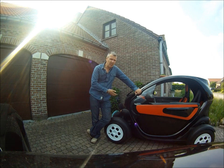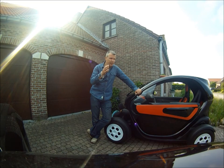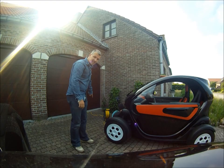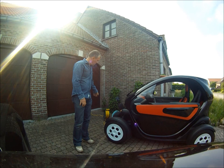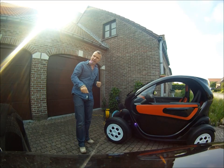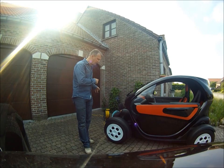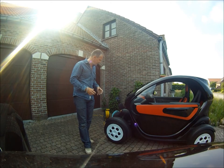The Twizy uses about 10 amps while charging. If you don't know electricity, that means you are already using half of the capacity of your line, your power cord. If an electrician would see something like this, he would say that is not done. You have all the cables in a bundle together and it creates an induction when being charged. You don't have to understand it technically — the cable heats up. It's even so hot that it can melt the plastic and cause a fire.